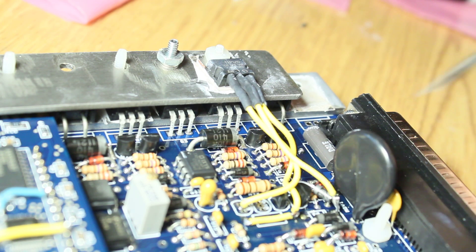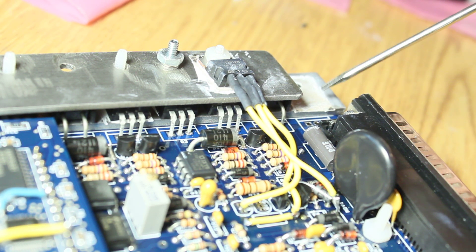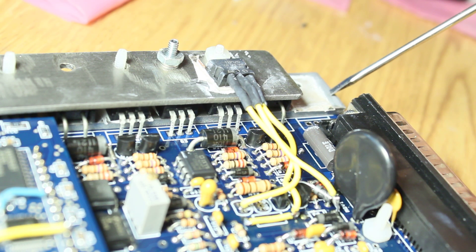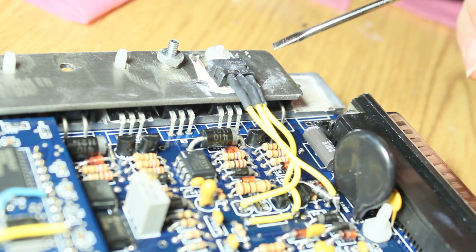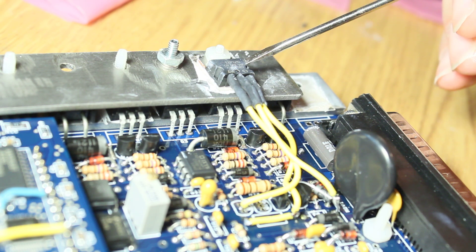So you need to wire into one of them. What I did was follow the MS-Extra guide that told me to put it down here in Q16 on the bottom heat sink. What I didn't realize at the time was that that was if you weren't planning on using a high-current coil driver, which I am. So luckily, I was able to just move it up — I didn't even have to rewire anything, but it's now up on my top heat sink.